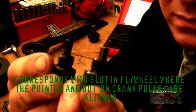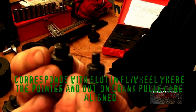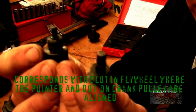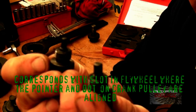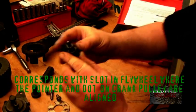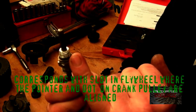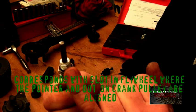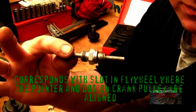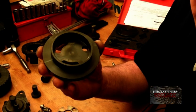These two here are your crank locking tools. They screw into where your wading plug would be on the flywheel housing. As you can see, there are two different sizes — one for the 200 and one for the 300 TDI, with different slot holes. The reason they're shaped like this is so that if you forget them and start the engine, they'll drop out. What I made myself for my 300 TDI is an air fitting with a hole through the center and a piece of steel through it, screwed into the same place to lock the flywheel so it won't slip when you're working on it.